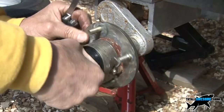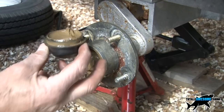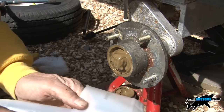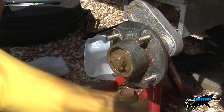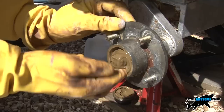Let's get the blade in there, peel that off and loosen it. There it is, coming off. Now I really do pack it in there, but underneath there's a castle nut and a split pin. We need to take that off to get the hub out to look at the bearings and clean it all out. So I'm going to put some new grease in this one. Here's another totally awesome tip: you've got all this gunk and grease to get out. Get yourself an old milk container — just cut it around like this, it's easy to cut plastic — and you can put that grease in there.